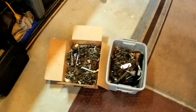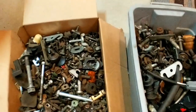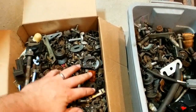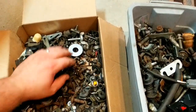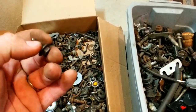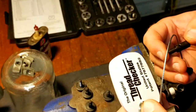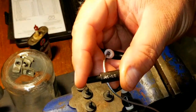I think I know where the last one is — I got a pile of Jeep nuts and bolts from all the Cherokees I've built in the last few years. It's like sorting through Legos when I was a kid. Here's one — oh no, the threads are stripped. So, one of the greatest tools you could ever own is a thread checker set. I need to chase one of these threads, so this is going to tell me exactly which tap and die I need to use.